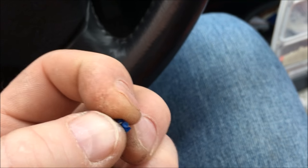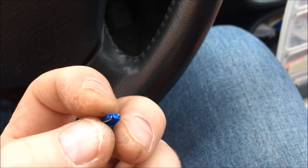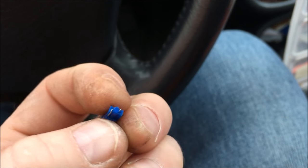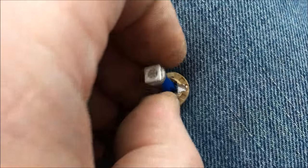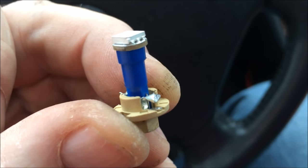Here's a T5 bulb. Push the two metal tabs to the outer sides - the two little metal legs - you want those on the outside. Now the two little legs are on the outside and we're merely going to push that into the socket. Since I don't want to push down on that SMD chip on the top, I'm going to grab the little blue shaft with a pair of pliers and push it straight back in to lock it. It needs to go in about another half a centimeter.